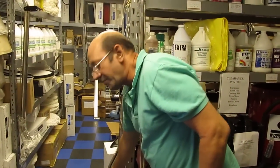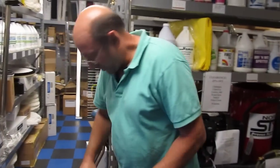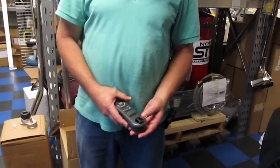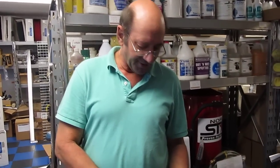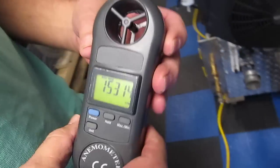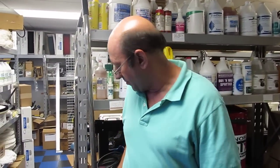We're getting about 10 and a half inches of mercury, which is about 141 to 142 inches of water. Earlier we sucked the propeller off our brand new anemometer measuring airflow, but we got a maximum reading of 15,314 feet per minute. When you multiply that times the area of a one-and-a-quarter-inch port, that comes out to 130.5 cubic feet per minute — and that's the highest it got before it broke our brand new anemometer.